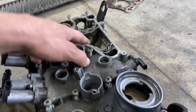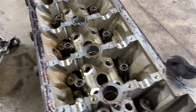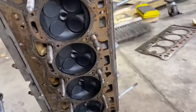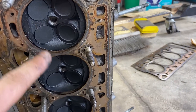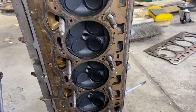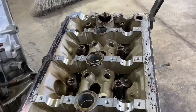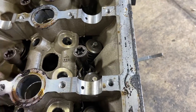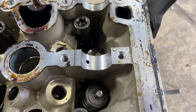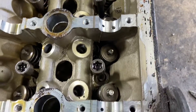So I'm just going to retire this cylinder head. Here's another reason why you might consider retiring a cylinder head. Everything on this one is legit when it comes to valve sealing — everything looks actually pretty beautiful. They all have the same color, the same consistency. But this was from a teardown video where a rod bearing had completely destroyed itself. This part all looks perfectly fine, but they can get a lot worse than this — this is actually salvageable.